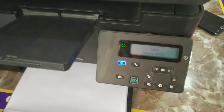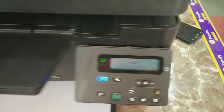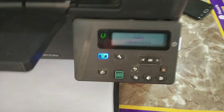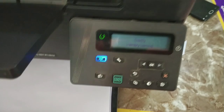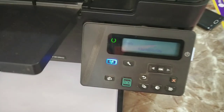Other types of printers don't have this problem after refilling, but this 126NW I was facing this issue. The fix is taping over the chip and my printer works normally. However, if you see replace black cartridge and do nothing, you cannot print from PC, and scan and copy will also not work.